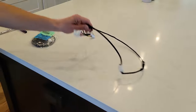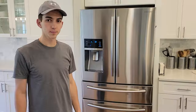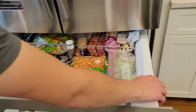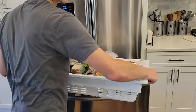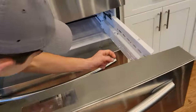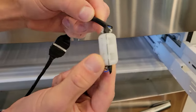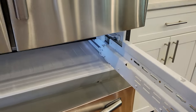We've already got the cable out. We're just going to show you how to swap it out. Let me show you why the cable went bad. Back here, if you take this thing out, you can get access behind — right here the cable runs behind this section and then it goes into the track inside the fridge. If you look at the cable, it's been cut in a couple places because it's been falling out of the track and getting caught in places in the track.